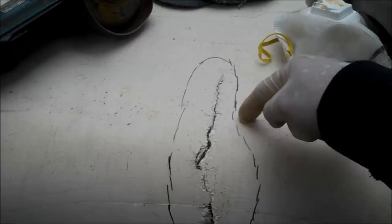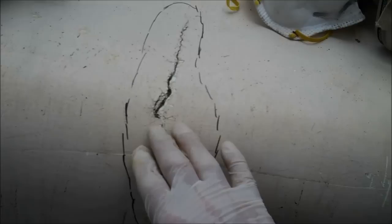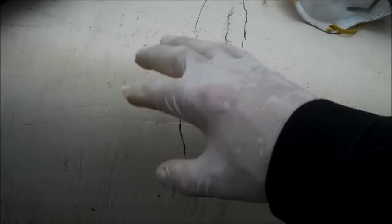I've used a permanent marker here to map out an area that I'm going to be preparing. Just by eyeballing it I can tell there's damage that's carried through where the impact happened. It may be counterintuitive to cause more damage, but actually you're getting rid of any of the weaknesses around the crack itself that were caused when the impact happened. I tested this out by pounding around it and there are no real inherent weaknesses. It's just that fiberglass gets micro cracks all the way around it when something hits it that hard, and I want to get rid of all that.